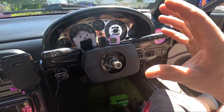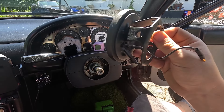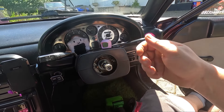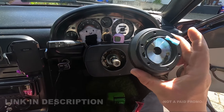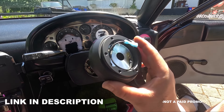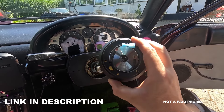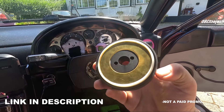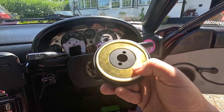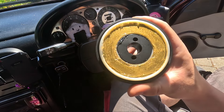Here's the steering wheel boss kit — this is the one I've just removed from the car and typically what you'd buy. But because it's about two and a half inches thick, if you install it and then the quick release on top, the steering wheel is going to be really close to you. So instead I've purchased a slimline one. I'll admit this is an NRG replica — the only reason I bought a replica is because it was a quarter of the price, but apart from having no logo it's pretty much identical. It's got the brass contact on the back so the horn still works and the two holes for the indicators. I'm putting a little bit of dielectric grease on the brass contact to ensure a good connection and prevent noise when steering.